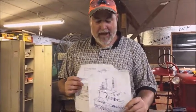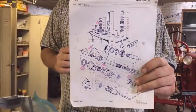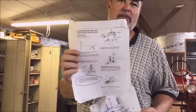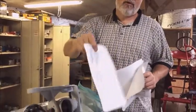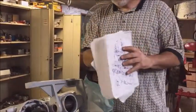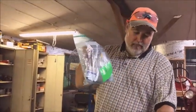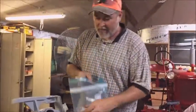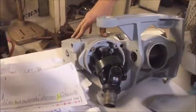Get a good schematic so you can see what parts you need to order. I've replaced all the o-rings and every seal. If you go online you can get instructions on how to disassemble and also get your parts list so you can track down what o-ring is what. One little trick that helped us: I went and put everything in a separate bag. Tonight I'm fixing the lower unit, so I got everything in the lower unit bag — the bolts, the seals, the o-rings. Same for the intermediate housing and upper housing, which we've already done.